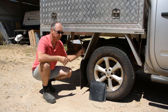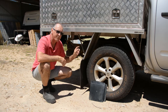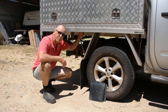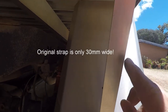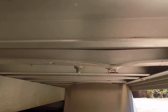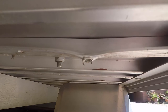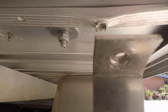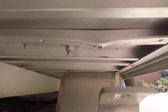This 40mm by 3mm aluminium strap is not strong enough. The plan today is to replace it with some 50mm wide strap. Instead of having one bolt here, I'm going to have two bolts at the bottom and two at the top. I need to repair this — as you can see, it used to be bolted up there, but the vibration has pulled the bolt out through the aluminium. We're going to put a wider strap, two bolts in this tray here, and reinforce this lip.